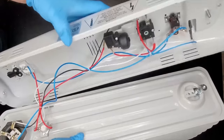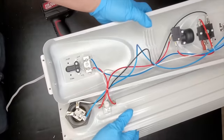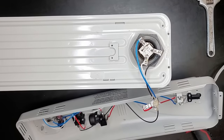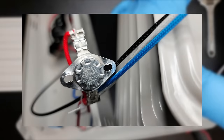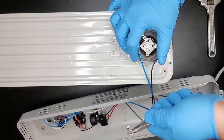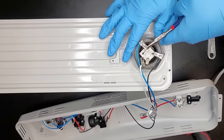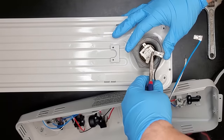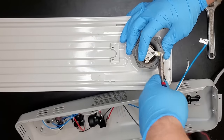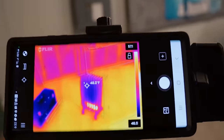Once we start tearing this one apart, there's only a handful of actual components inside: an anti-tipping switch, a thermostat, a switch to regulate the electricity, and a thermal safety fuse. As an appliance tech, I found it interesting that this fuse is quite literally identical to the one you'd see on a Samsung dryer — the only real difference being the temperature value needed to trip the fuse. It's a switch of last resort; if it blows, you'd need to buy a new heater. The only other piece is a giant heating element that heats the oil to distribute heat through the entire unit.